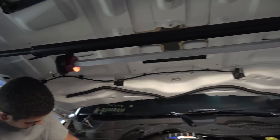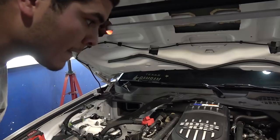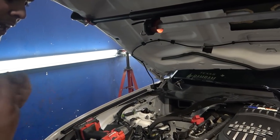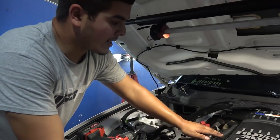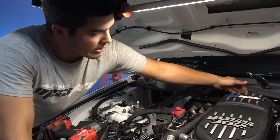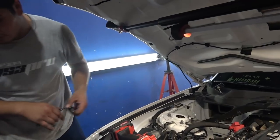Just so we can get our hands in there, we take everything off from the bottom — header drops. You want to take it out because it lets extra light in so you can see from the bottom and top. We're taking the intake off just so we can pick up the engine, because we've got to move the motor mounts off and everything, remove them so we can actually get the headers out. Since this is a Boss 302 intake, it's a lot taller than the factory intake. Whenever we raise it, since the transmission is still hooked up, it's basically creating a pivot point, so the engine is gonna move back as we pick it up. We don't want to accidentally crack it. A factory intake won't hit because it's flush — it's real low compared to this one.